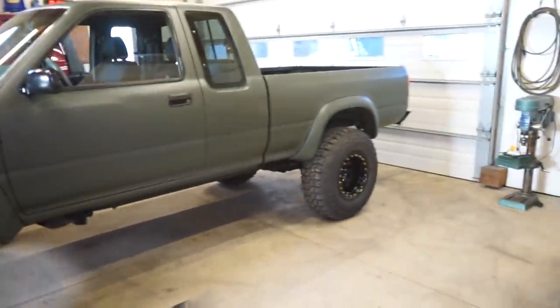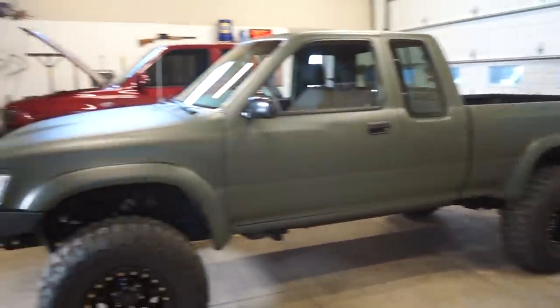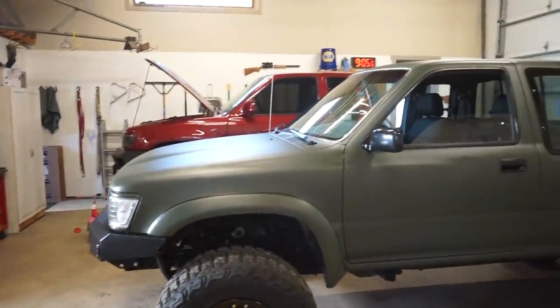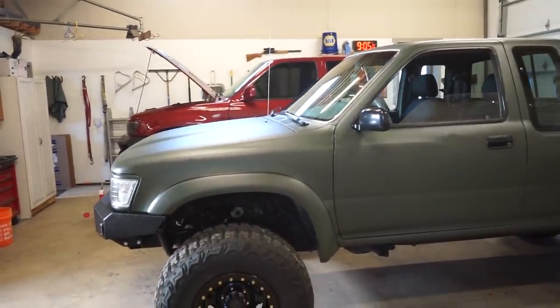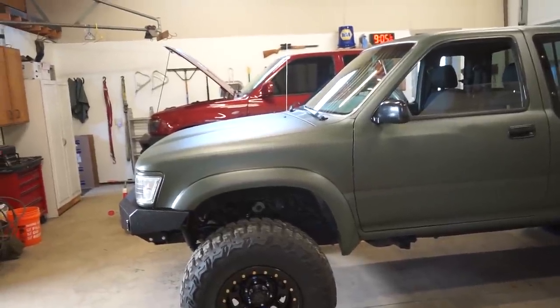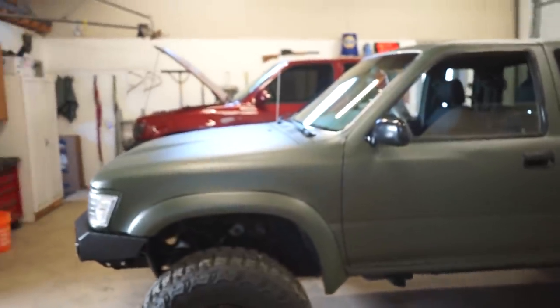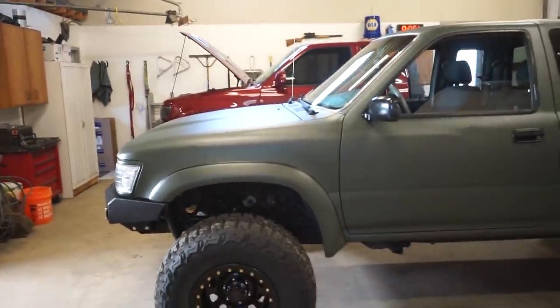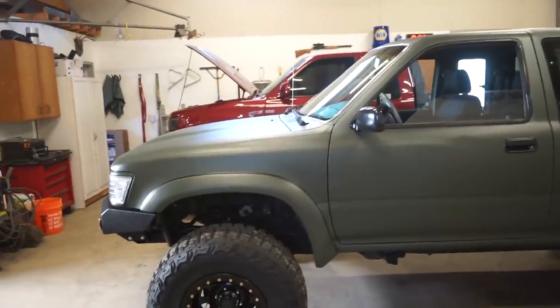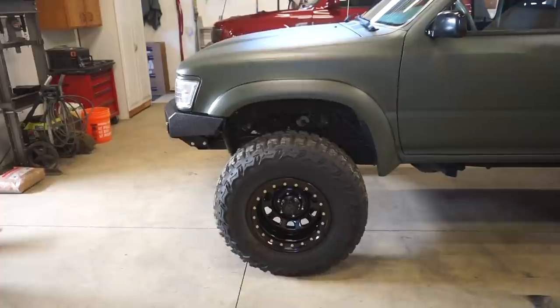Like I said, the rear brakes are all brand new, so I know that's not it. I've tested the brake booster. It's holding vacuum. Like I said, the pedal feels perfect. The pedal feels amazing. So I don't think it's something to do with a master or the booster, but I suppose it could have something to do with a master if there's a small internal leak or something, bypassing pressure and bypassing fluid. Either way, we gotta swap these out. Not too big of a deal.